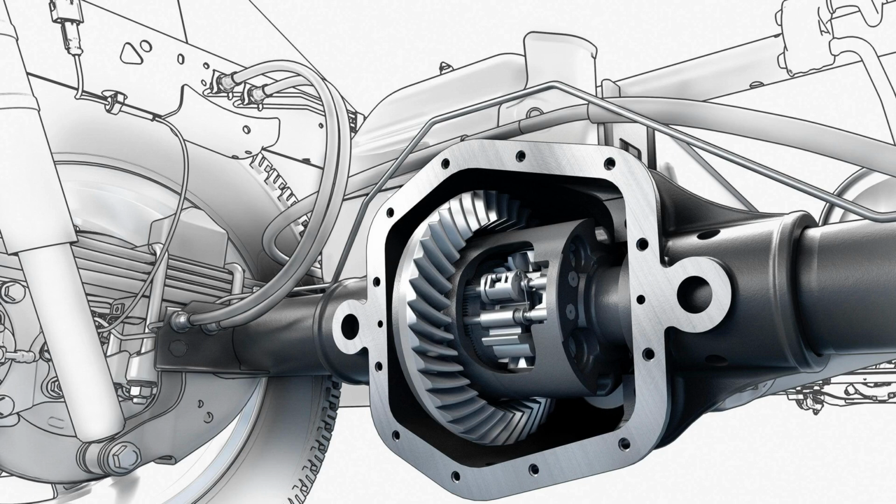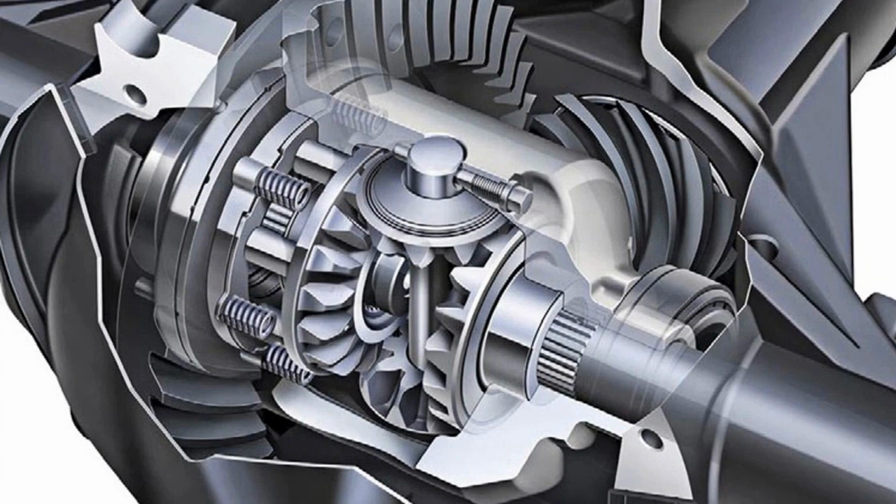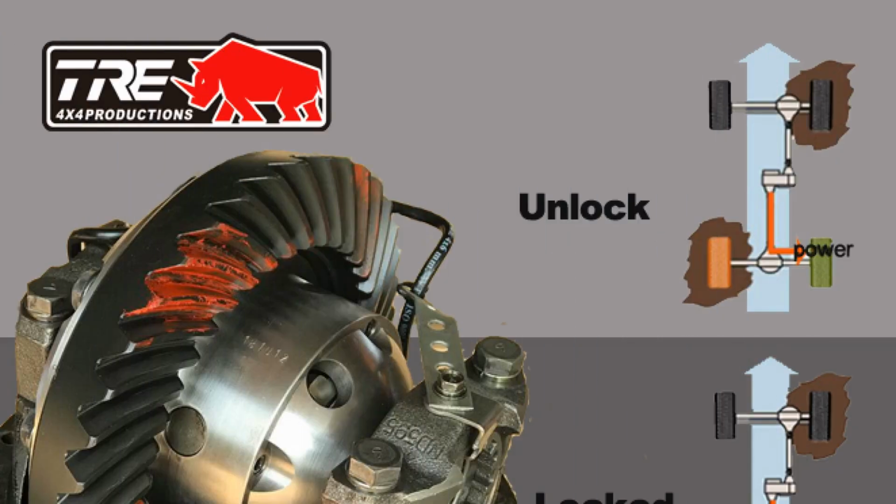Automatic, forced, activated by the driver. According to the method of locking control: mechanical, electromechanical, hydraulic, pneumatic. A self-locking differential is a mechanism that under certain conditions switches and, turning into a direct gear, begins to divide the rotational speed of the cardan shaft between the half axles equally. Differentials with automatic locking can independently lock depending on the value of one of two parameters: the difference in angular velocity of the half axles, or the torque transmitted to the semi-axles. This group includes differentials with disc locking, cam differentials, differentials with viscous coupling and differentials operating according to the Ferguson formula.